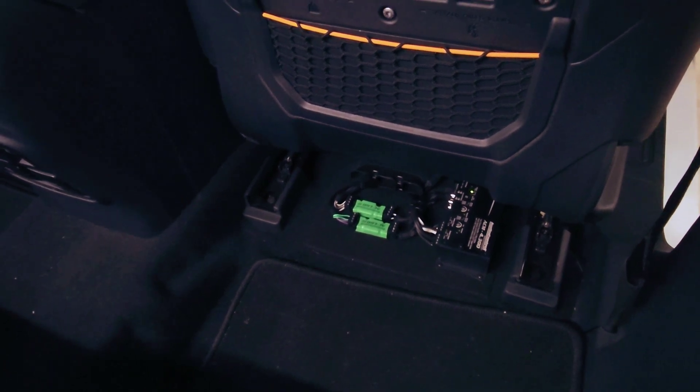That's how you have to set up the 2022 Broncos. I've had a few other shops and installers say that's incorrect and you don't need load resistors. But the fact that AudioControl actually confirmed this — it was part of their training at KnowledgeFest, and they actually have a spreadsheet with photos showing what load resistors need to be used with the B&O or non-B&O system — kind of proves that the 2022s do need load resistors.